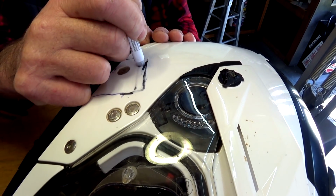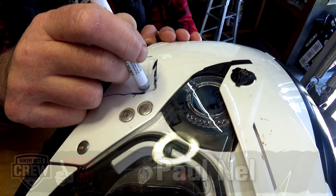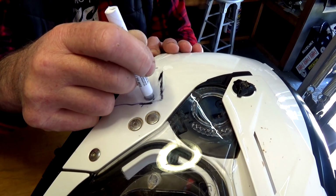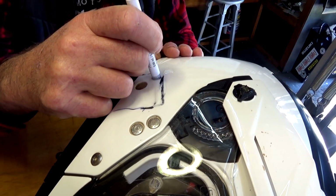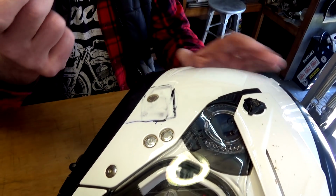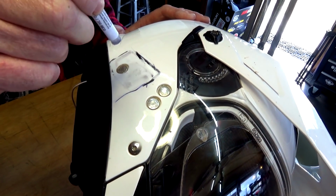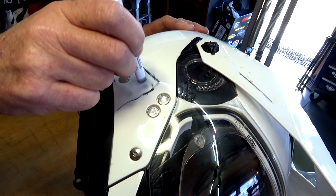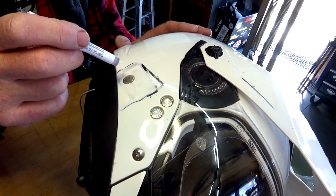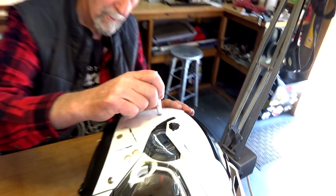And you've got to be very cautious that you don't get it on paint. You only put it on the areas that you know you're going to be using to adhere to, because once this stuff's on, it doesn't come off. It's super powerful. It's picking up that texture. That video that you showed me, they were saying you've got to get some whiz-bang chemicals to be able to remove it, and then you've got problems of removing your paint. And if you feel like you're not getting enough, just squeeze the tube a bit, and it comes down. Yeah, you can see that. But you can apply it after 2 to 5 minutes, or you've got a 45-minute window. Oh, okay. All right, so there's no reason to panic.